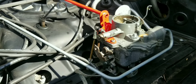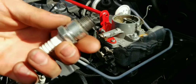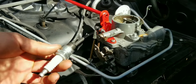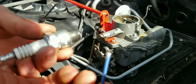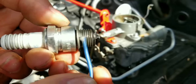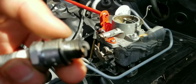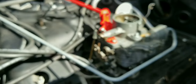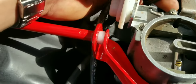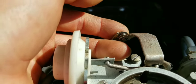This side looked good and I'm going to go ahead and put them back in. One thing I want to mention: I'm going to be putting some anti-seize on these threads because these are aluminum threads, and I heard you're supposed to put some anti-seize on them. I'll just put a little bit on the bottom threads right there and that should be good. And just a quick check on the chokes — when it's fully closed, this rod should just slide in as so.